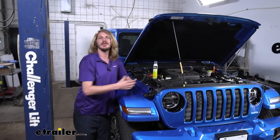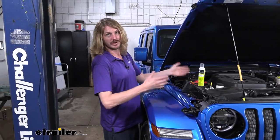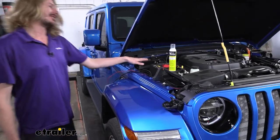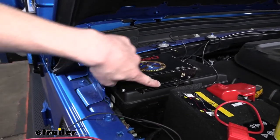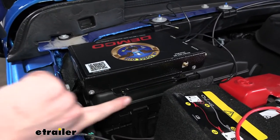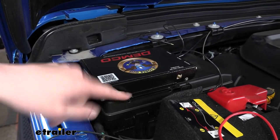I like to know where each component is going to be so I know the lengths of hose and wiring I'll need, and whether I have enough to reach. We mount the main operating unit right on top of the fuse box cover, attached with cable ties that came included — we drilled some holes in the side of the fuse box cover and ran the ties through those holes and through the holes on the unit's flange.